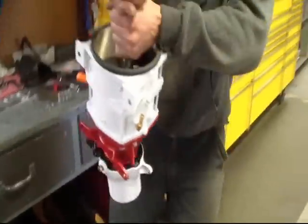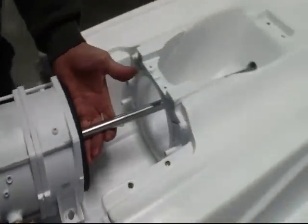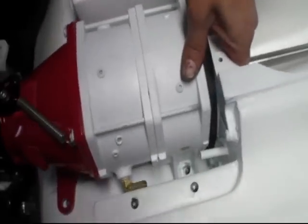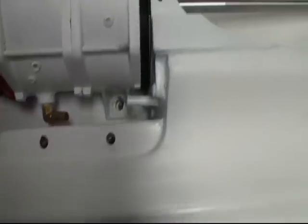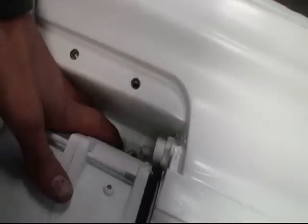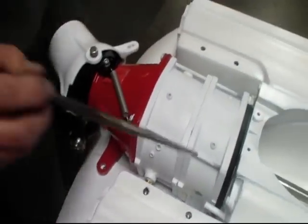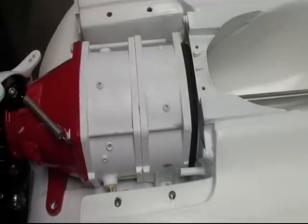Let's take the pump and go ahead and slide it on in. Just sitting there without any hardware, you can kind of see how your holes are offset — you can see like a half circle sticking through the pump body right there on each side. What's going on there is the pump seal is actually pushing you back, which is good. You want that.